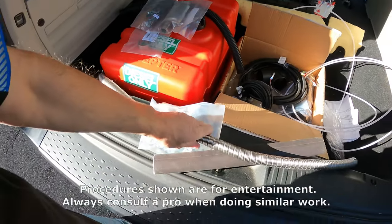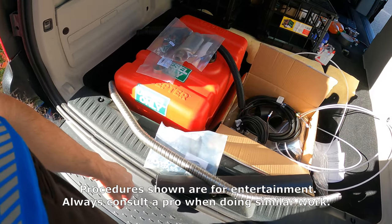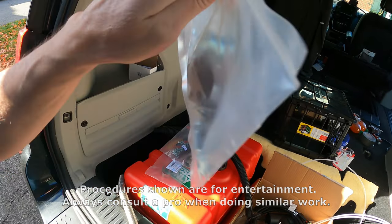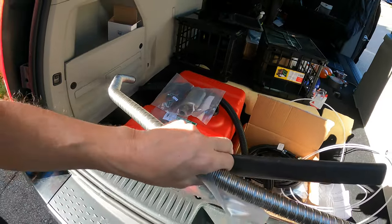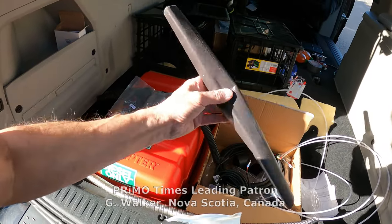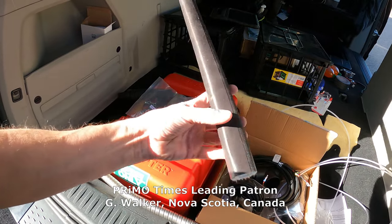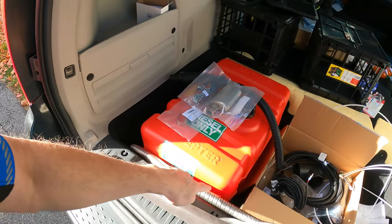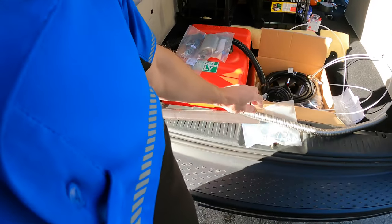At any rate, let's go under and let's do the exhaust first and just see whereabouts we can put this. So I will bring, is this the exhaust kit, mounting kit, exhaust pipe? Yes. So we'll take this down with us as well, the exhaust pipe, just for fitting. And there's also, by the way, this is pretty cool, we have this insulating tube fabric made of, I assume, so I won't say asbestos because that would be bad, but because the temperatures coming out of the heater exhaust are so high, there could be plastic connectors or wires or something right around the immediate area of the heater, and you want to protect those. So that makes sense to have that.